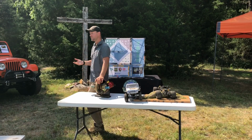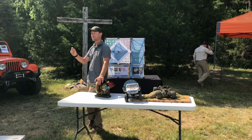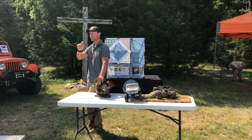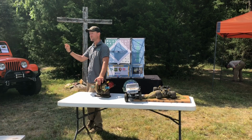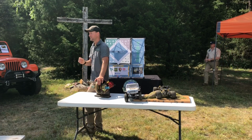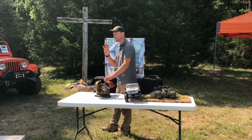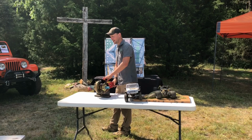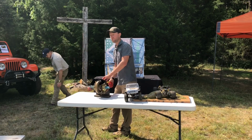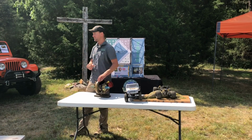Now, especially with newer vehicles, the reason for that consistent throttle is because now instead of a throttle cable with an older vehicle like your Bronco, our newer vehicles like our JK have a little sensor that talks to another little sensor that tells the computer how much we're pushing the throttle. And it's extremely touchy. So every time that we manipulate that throttle or bounce our foot on that throttle, we engage kind of like stomping on the ground. So we're really putting a lot of effort right into one quick movement to our tires, okay?